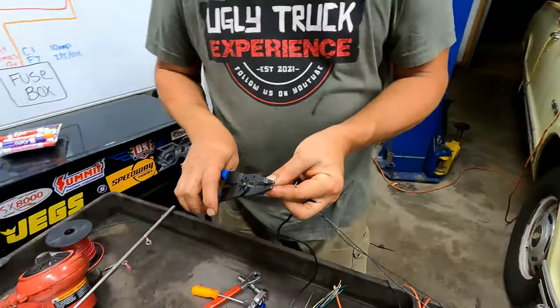All right, so the data connector. This one comes out of pin number 2 on the OBD2 connector. It comes out of the connector purple, but it goes and meets up at the PCM with a green wire. And it's this connector. Hopefully, if you're working on that vehicle, it has light green tape on it. But this one supplies just about everything that I need. That's the data connector right there.